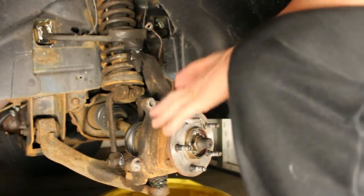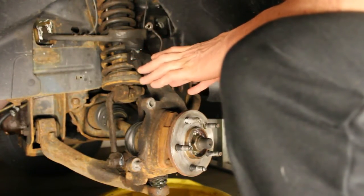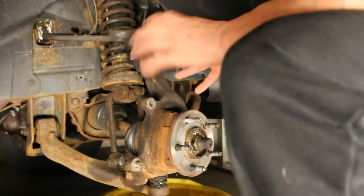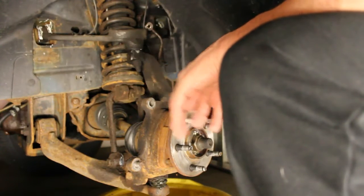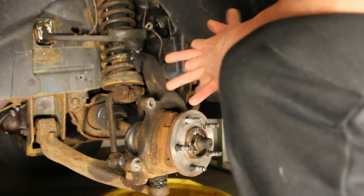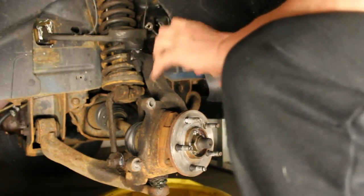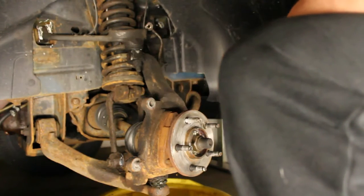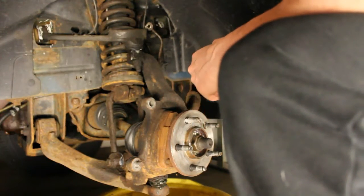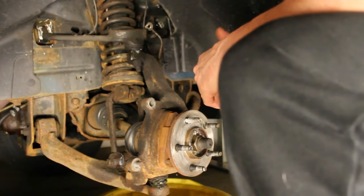Okay, so it's important to note too that it got real hot. And you could feel some resistance. When you're driving a vehicle, it should roll at a nice pace. This had some resistance where it was actually slowing down. And then if you stopped, this area here, the brakes, would make a noise similar to a muffler when it's cooling down. That's how hot it had gotten. So we're going to put this new caliper on. I think the other caliper was locking up. It's ready to be replaced.